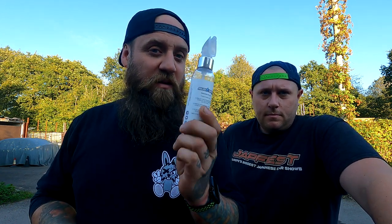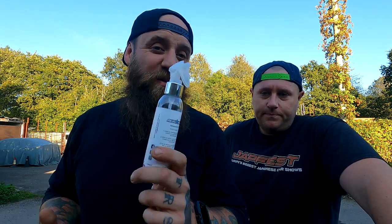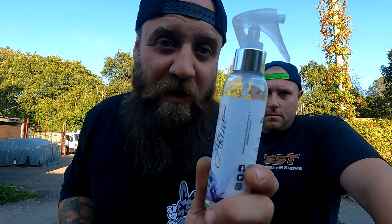It's so easy to use — you literally just spray it on. Your car's got to be wet, so do it after you've cleaned your car. So you do your usual methods: your rinse, your snow foam, your rinse, your citrus pre-wash if you want to, two-bucket wash with shampoo. Then you rinse it off, and then before you dry it, that is when you add this. Then once this is added, you dry your car. It's that simple — make sure your car is wet, that is key. Do not let it dry, otherwise it'll be a nightmare to get off.